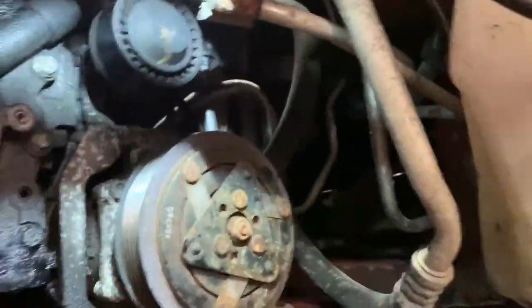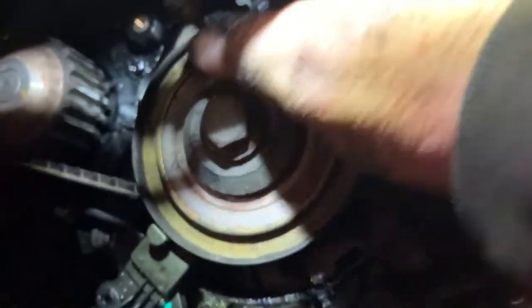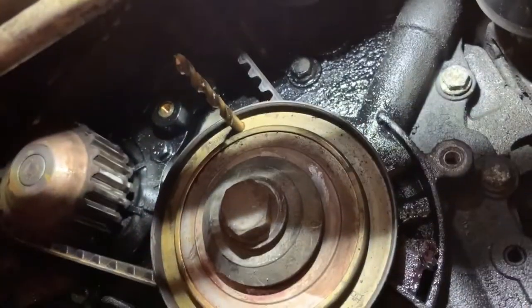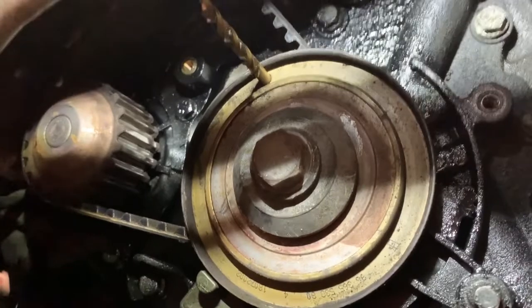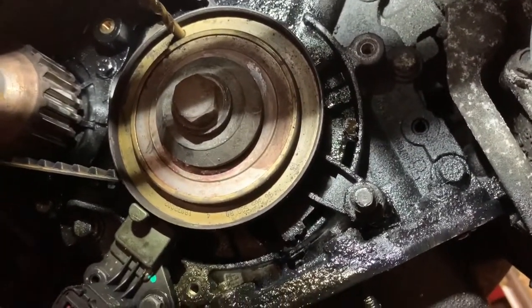And then down under here, once again, sorry about the torch work. The torch is kind of lodged, hold on, swap hands. And there's your bottom mark, and that one slides in there. So there's your two timing marks. So no need to put a little bit of paint on the wheel.